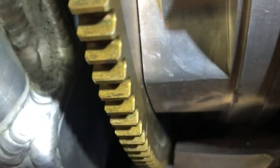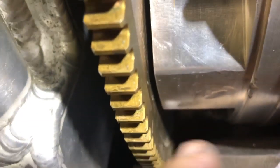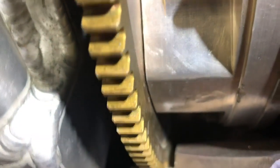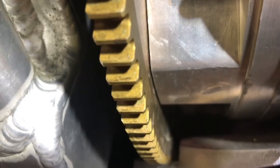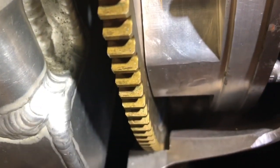A lot of people get very confused. What they will do is push it to the flex plate and then measure it and say: I need it 125 or 150 thousandths. So if it had 250 thousandths there, the torque converter is pushed too far forward. It's going to pull the converter out of the front pump of the transmission and out of the input shaft. When it does that — if it's too far forward — usually the transmission just doesn't move, or it barely moves because the front pump is not working properly.